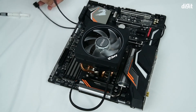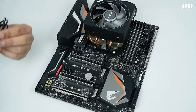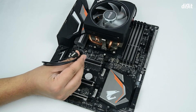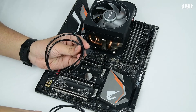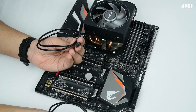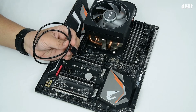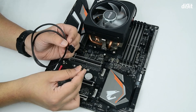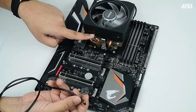If you want, you can attach the optional RGB connectors onto the motherboard as well. With the Wraith Prism coolers, you have the option of using either an RGB connector for the RGB function or you can use a USB connector for the RGB function. In this case, we'll be using both. First, we'll proceed with the USB connector. The connector on the USB cable is a 3-pin connector which goes onto the right-hand side of the Wraith Prism cooler.